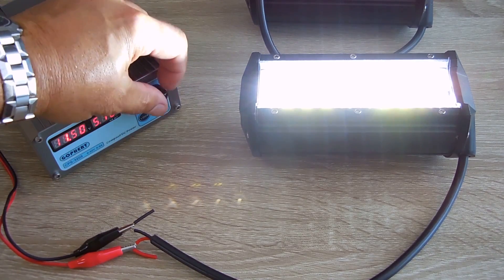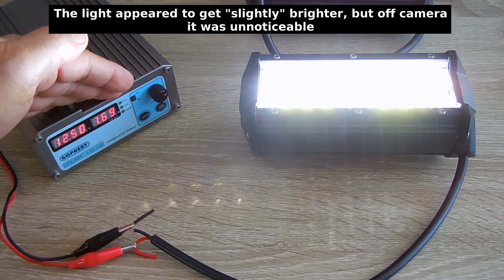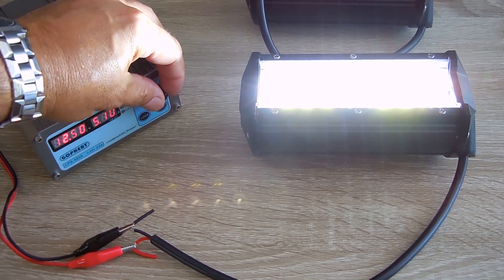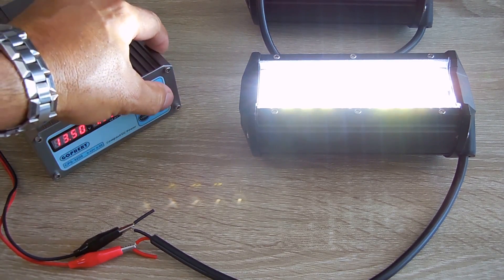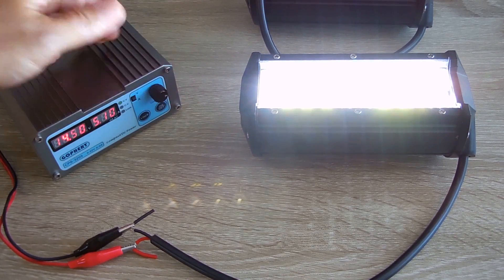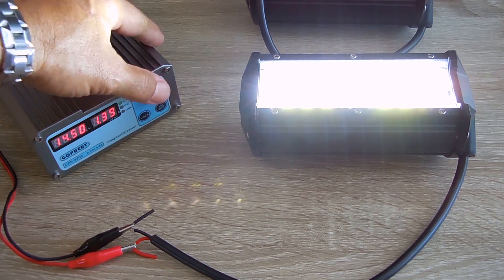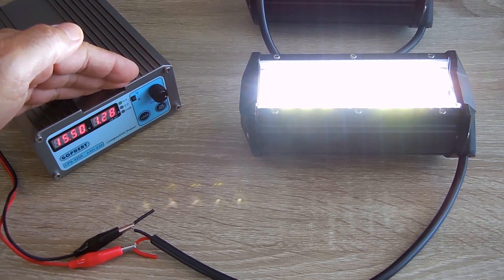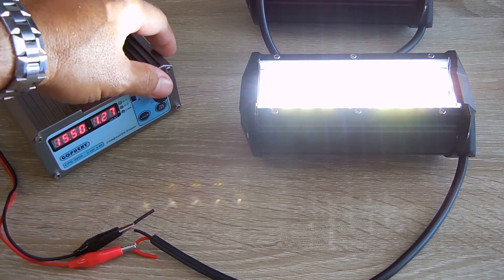You see it just stepped up in brightness, drawing 1.87 at 11½. Now when I go to 12½, you'll see the brightness does not change, but the current drops — now it's 1.69. And if I go to 13, same level of brightness, current is down to 1.5. And if you go to 14½ like the alternator is running, same thing — current's down to 1.39. You can go up to 15½ if you want — 1.2 amps. So both of these together will be drawing right around 2.6 amps at that voltage.